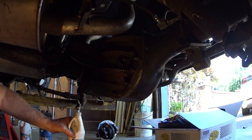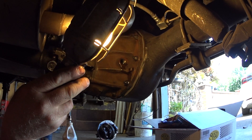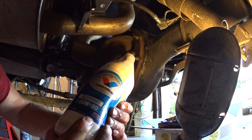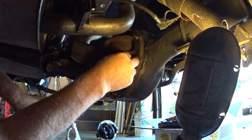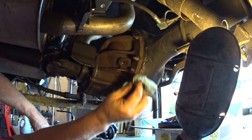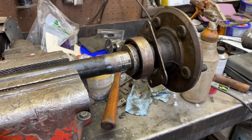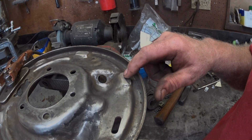I think I'm there. It just came gushing out when I turned it backwards, but turning it forwards doesn't do that. I'll just leave it like that for now and top it off. I assume the True Track unit needs to have oil circulated through the inside of it — that's how some gushed out. Tighten up that plug and this install of the third member is complete. I put in three quarts — emptied three bottles and half of a fourth. There are two problems in this picture of the axle — you have to wait for the next video to find out what they are. Coming up next: it's axles and brakes.